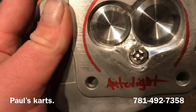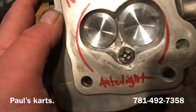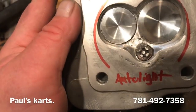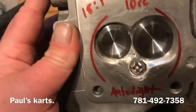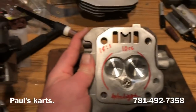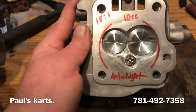As you can see, this is not optimum. The chamber shaping has not been completed right now — you can see some of this area is still kind of wonky. We were basically just marking it out and doing the rough shaping first. Still need to get the seats put in and then it's going to need its final shaping. I just wanted to get some video out there of the cylinder head.